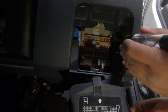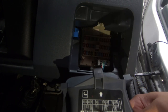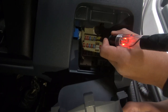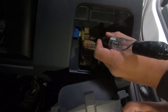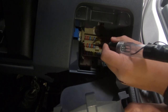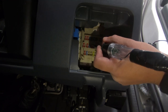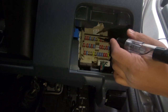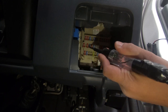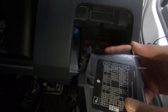We've got ignition here: 10, 10, 10, 10, 20, 15, 15, 15, 15, 15. Now we know where we are — map out what we're going to tap onto. Probing the pins: these are lighting up, so these are constant power fuses. The ones that don't light up until you turn the ignition on are ignition fuses. We don't want to just pull out any fuse. We have a little fuse puller here because if we pull out an airbag fuse, that's a major issue.